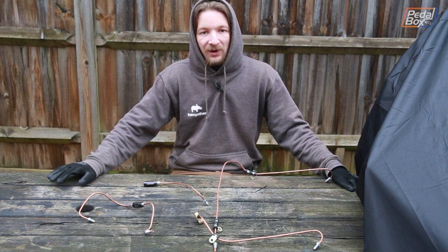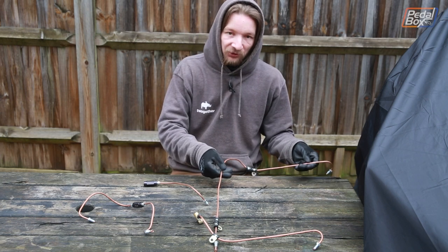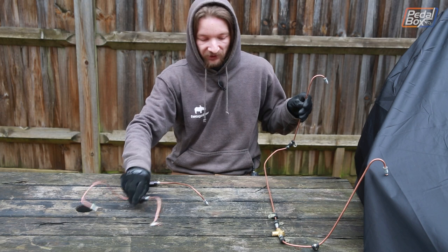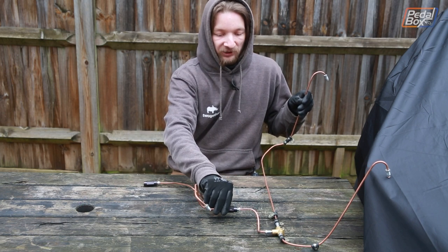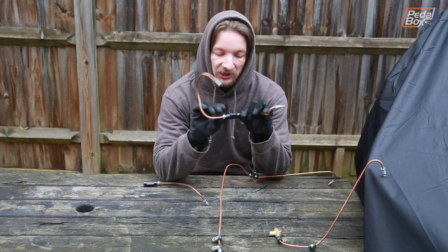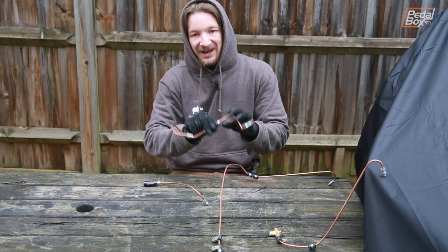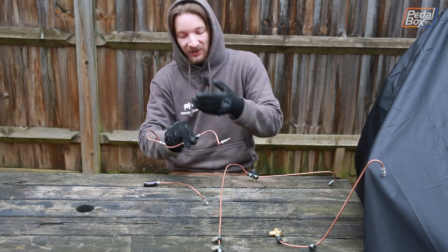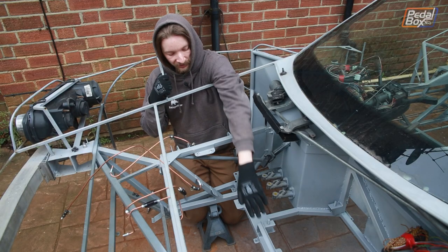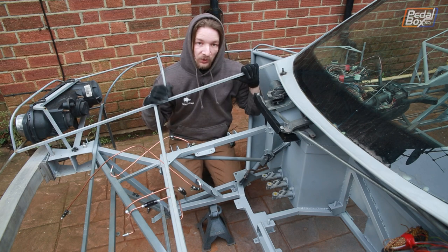While we've been without a welder we've been figuring out other things to do. Thankfully our brake system is hopefully going to stay nice and simple. These two pieces go to the front corners — that's the actual front brakes driven by a little T off the master cylinder — and that connects into the top of the master cylinder just behind, so this whole thing fits inside the front end in front of the bulkhead. These two extra pieces are 2 PSI pressure retainers, or one-way valves, that help keep some pressure in the brake system. Because our master cylinders are down at the bottom of the car, without these the brake fluid could drain back and refill the reservoir, meaning we'd have to pump the brakes to refill the system on startup. Last night we put in the cable tray and our little front support for the pedal box to support the brake lines, and we're going to start installing all of those now and work our way back along the rest of the car.